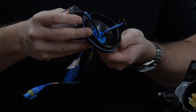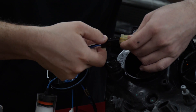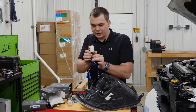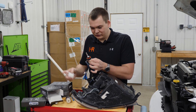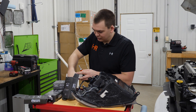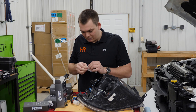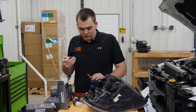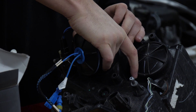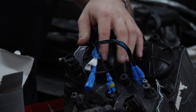The grommet's installed properly and we've got our dust cover. Plug the bulb in like so. I've left the protective clear hard plastic cover on the bulb this whole time — the last thing you want to do is bang it around a dirty workstation and contaminate the bulb, as that can cause premature failure. GTR Lighting includes a little alcohol swab in the container. It is always highly recommended to clean these bulbs just before you install them. Wait until the last possible minute, clean the bulb, and install it in the headlight. Tuck your wiring in, twist your dust cover into place — it looks like it came from the factory.